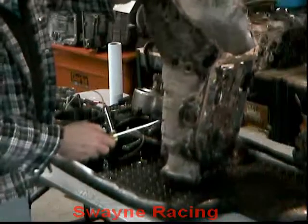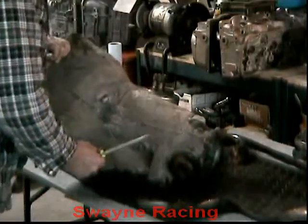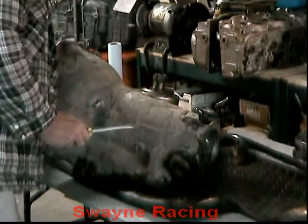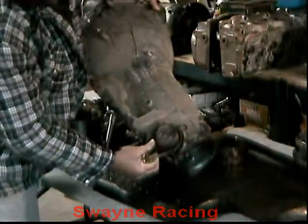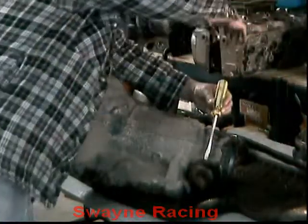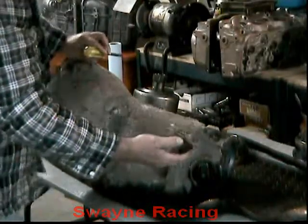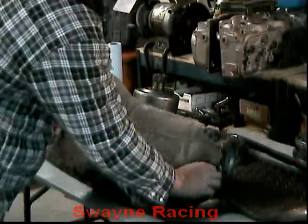Back to the case. We have a governor on this side. There's just a large clip — it snaps on the bottom. Just snap that clip off and work it out of the hole. Then there's a cover here. You just want to take a hammer, get it behind the cover, and knock that off. I had a real hard time getting it off and I dented the cover — that's because it's been on there so long. If that's alright, we can straighten that out. That's the governor here.